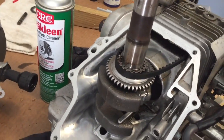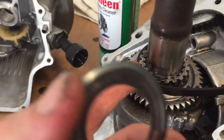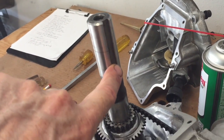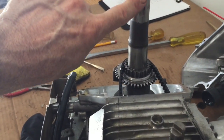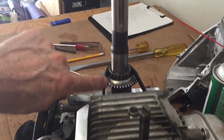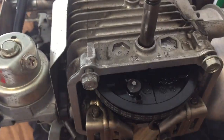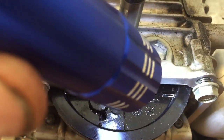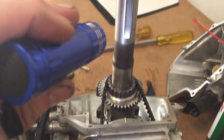You can use soap and water if you want. Once you're at this stage, you are going to remove this thrust washer, which will give you the opportunity to take this timing belt off, and then you are going to remove this cam retaining pin. Before you do that, make sure this cotter pin area is facing towards the motor — this is the top dead center for the engine. On the timing cam itself, there are two little marks: one mark there and one mark there.